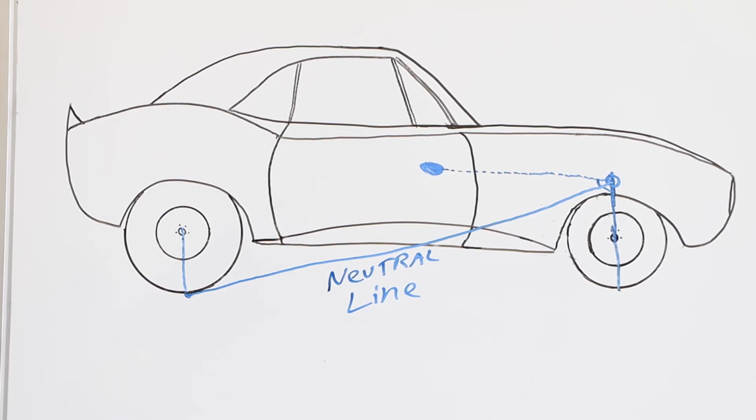For those 4-link combinations where the instant center falls right in line of force, the chassis will not pitch rotate at all. It would be like balancing the car on jack stands, except that the car is in a dynamic state. What this means is if you want to hit the tire very hard, choose an instant center location well above the neutral line, also known as the 100% anti-squat line. Placing the instant center below the neutral line will be more accommodating to high torque combinations where less load transfer is needed.